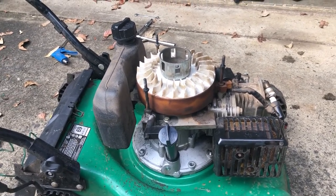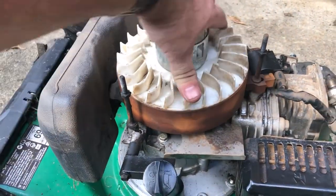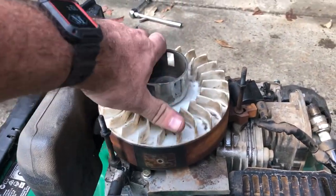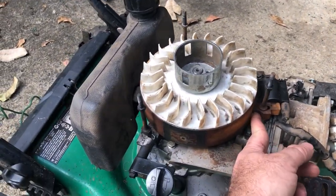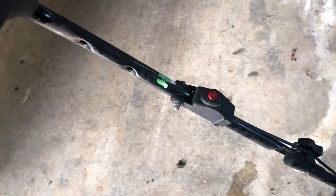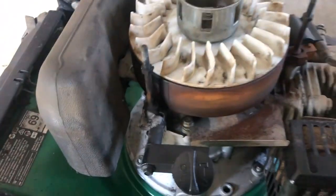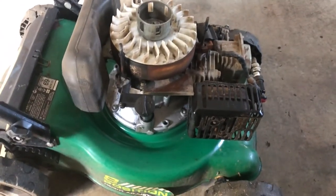I checked for spark and it's weak and intermittent, which is probably because the area around the plug has gone all rusty. I'm going to run the wire brush over that, and if that doesn't fix it this will need removing and sanding. The other concern was whether the kill switch was working, but now that I've wire brushed it a bit and turned the kill switch on - you can actually see it does have spark again, so we're almost on track.